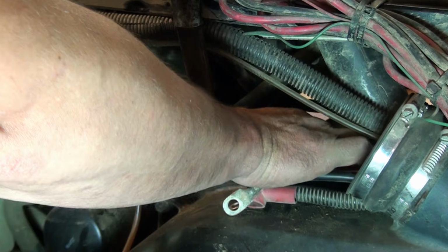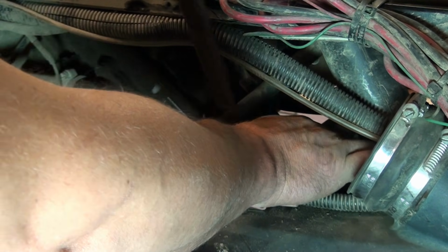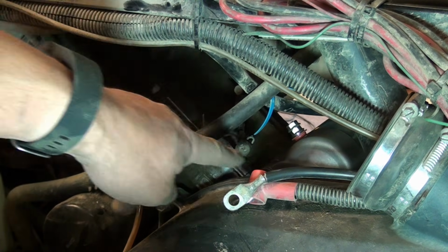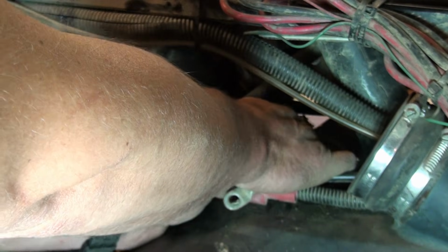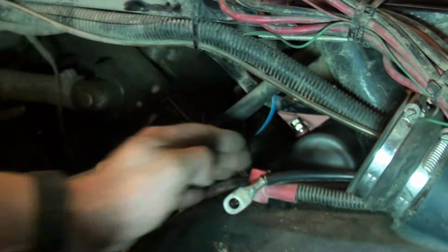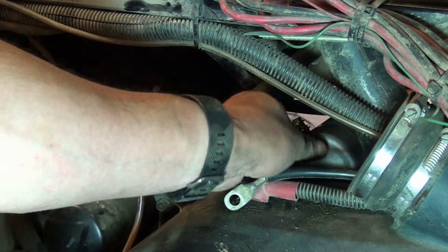And obviously we shortened up that bolt significantly, so that should be good. What I'm going to do to make sure I have the right location is I'll try to thread this one in before I attempt to thread the other. And I just felt that O-ring seat, so that's a good sign. Okay, I'm going to leave that one a little bit loose because I'm going to want to jiggle this motor as I attempt to thread the lower one,